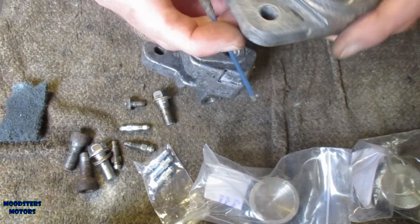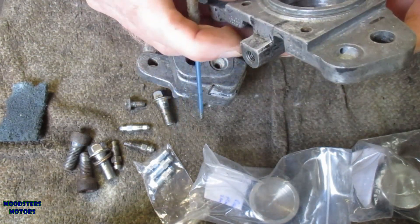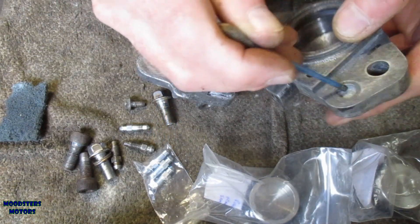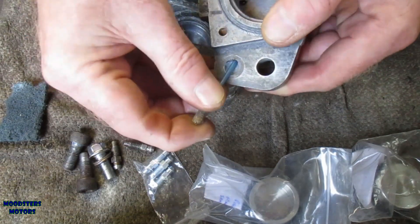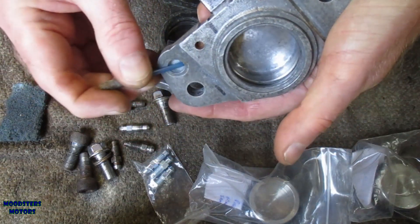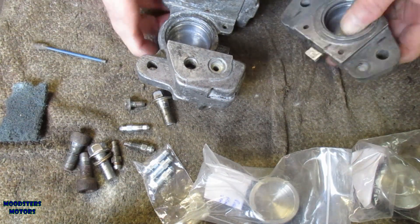The one from this half was a little bit more tricky — although the feeding for the bleed screw is straightforward enough, the actual transfer comes in from here into here. Fortunately it's on a bit of an angle which does make it slightly easier to get through. I think I've cleaned out the worst of those, so I think those caliper bodies are now ready to paint.